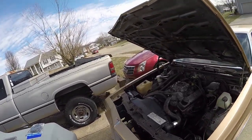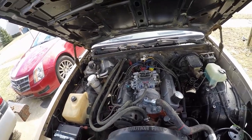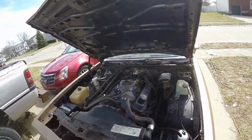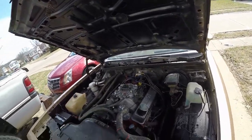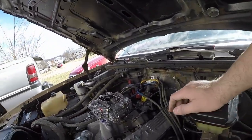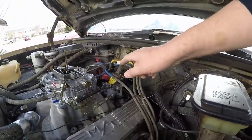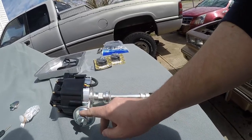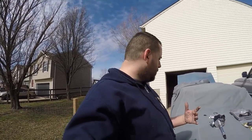He's pretty unhappy with the way it looks under the hood. Many years back, steel braided hoses were real popular — they're kind of looking pretty bad now. We just want to clean up underneath here. This engine would have come with the HEI distributor. For some reason when he swapped in a 350, they removed the factory engine and put this distributor in. What I don't like about that distributor is it's lacking the vacuum canister. That vacuum canister can add like 10 to 20 degrees of timing at idle or real light throttle, and that helps with the power.